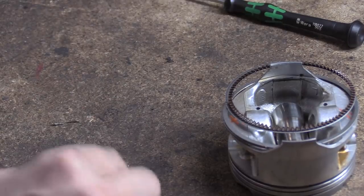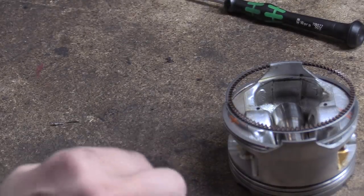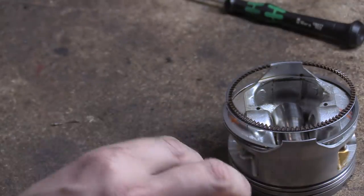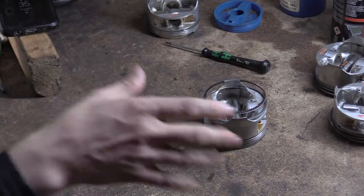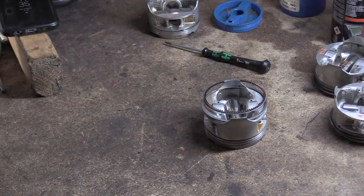Right then, it's time to move on. We're going to start taking off the accessory covers — we'll start with the end of the crank nose because we're going to talk about witness marks, and I know there'll be a witness mark under there — there always is. Then we're going to start on the clutch. In the meantime I'm going to carry on with the teardown, and I'll also drop in videos on measuring — measuring the wrist pins, the pistons, the valve stem diameters and so on.